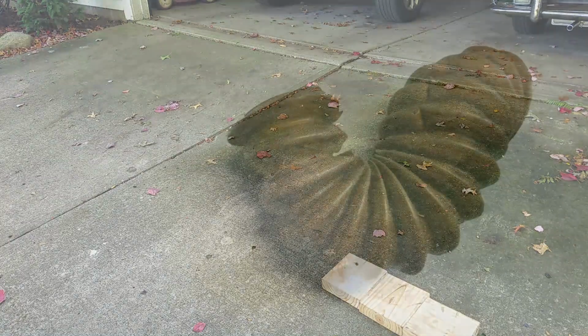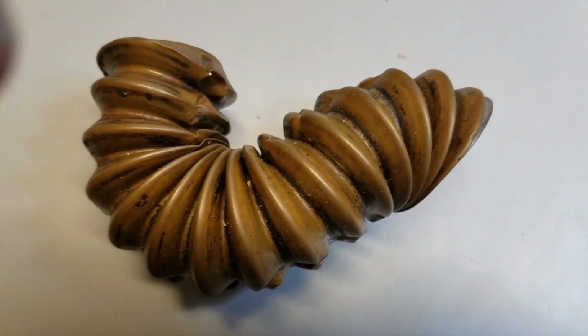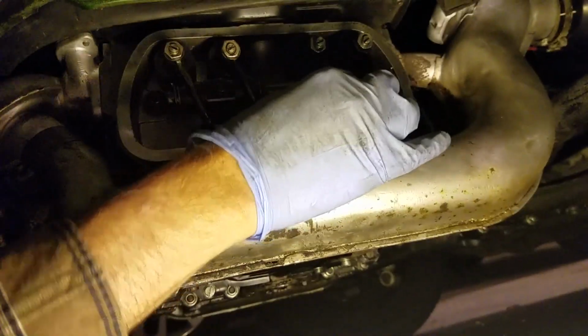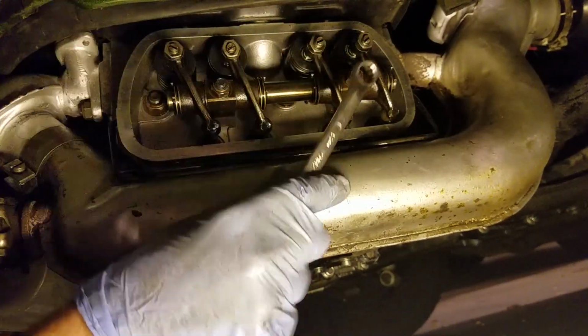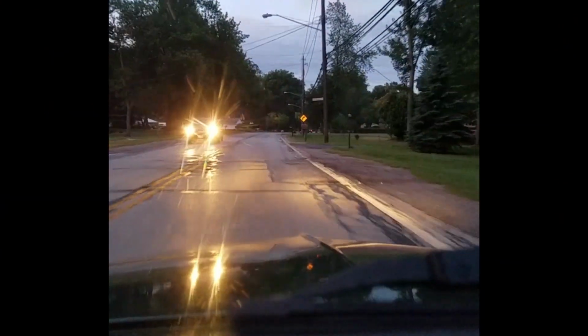That bang is the thermostat overheating and turning into a snake. I immediately checked the valve lash again and found the valve clearance problem as well as the destroyed thermostat. I removed the thermostat and readjusted the valves. On my first few test drives, everything seemed to operate okay.